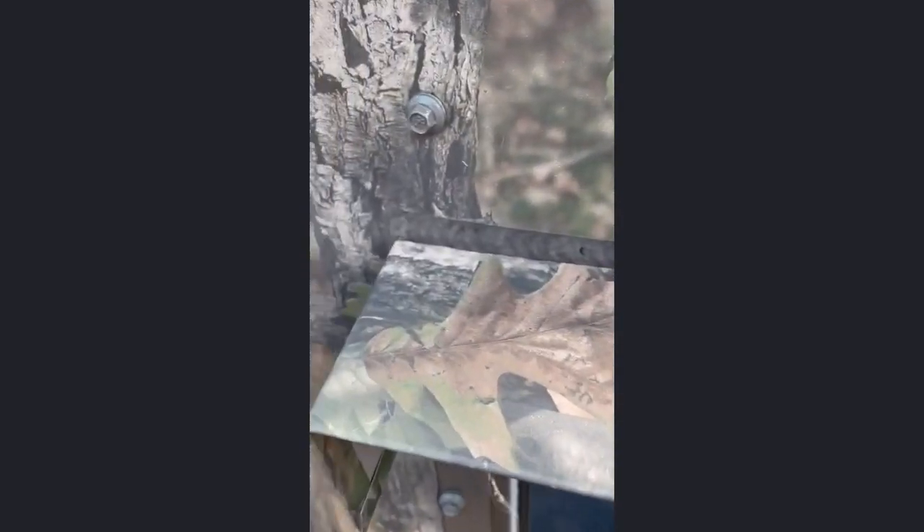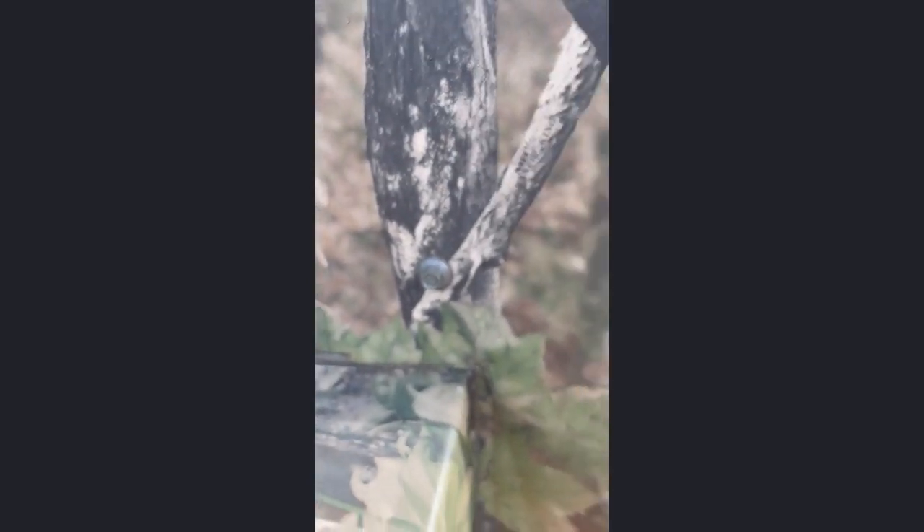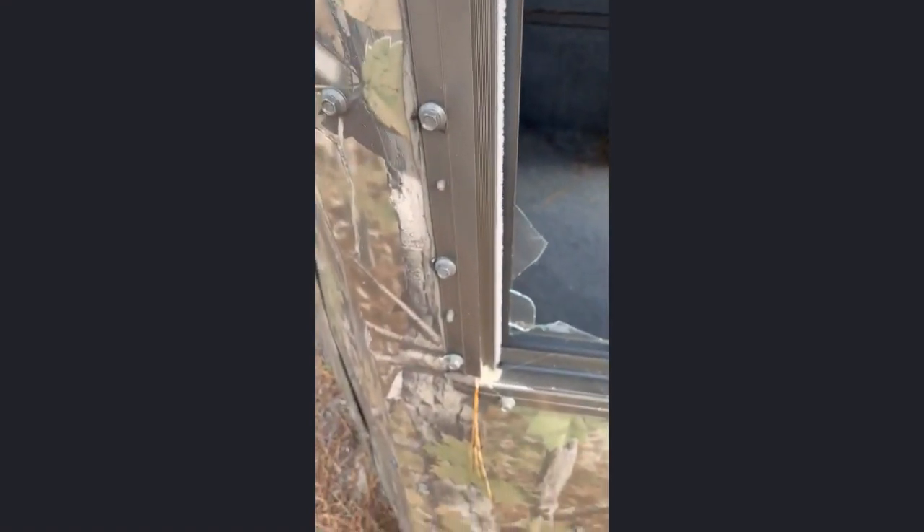I finally got some of the caulk off — I'll finish taking the rest off in a second, but that is the rivet I'm talking about, and you can take that out pretty much just with a small drill bit. Next, take your five-sixteenths socket and remove all these self-tappers. You've got some up here along the top and then obviously the ones here on the window.